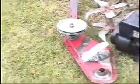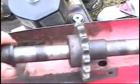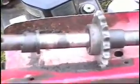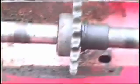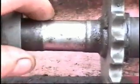Another bad issue, this is kind of bad, is the tine shaft itself. There's bushings there. I don't know if you can see that, but there's some pretty bad wear on there that shouldn't be there. These are just little plastic bushings that go on there. That's pretty badly worn there.